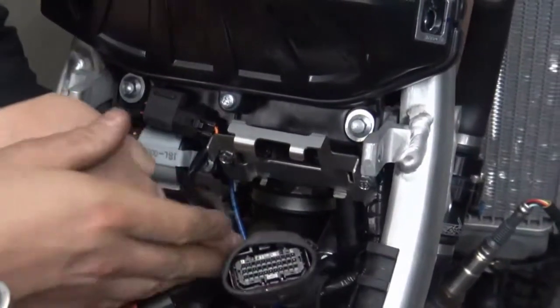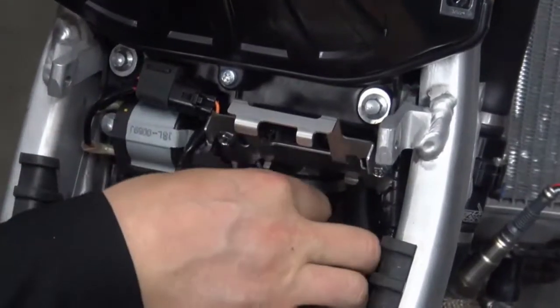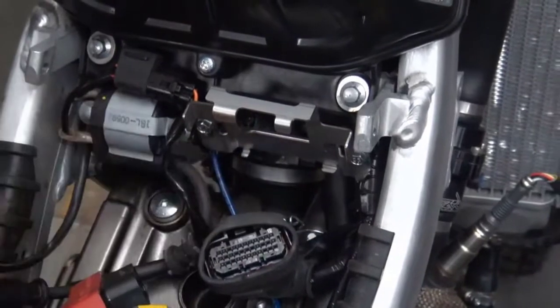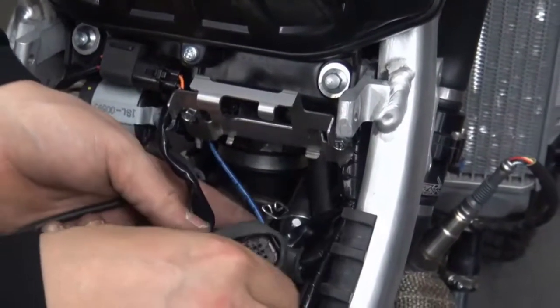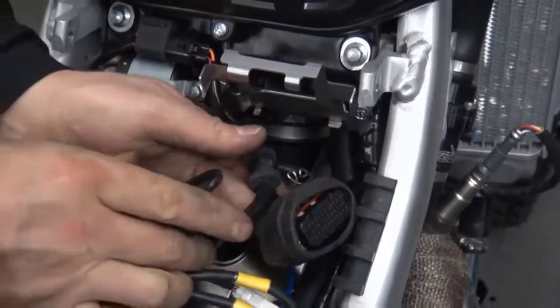It's very important, this nitrous line. These bikes have a harmonics when they run, so they'll vibrate on stuff and rub through. So make sure it's not rubbing on anything. We put the spark plug wire and all the wires on top, run it down low. Once you've done that, drop your spark plug back in.